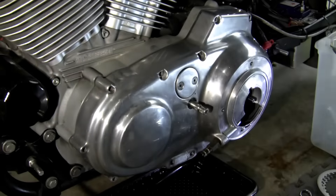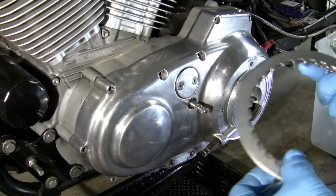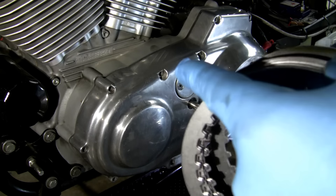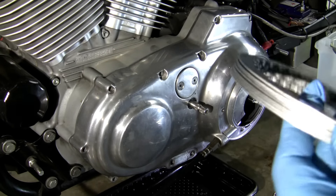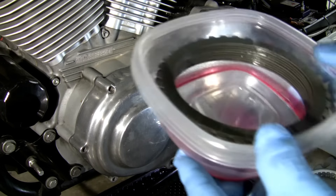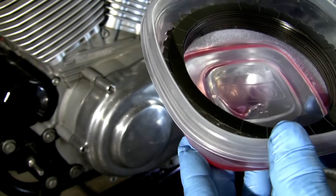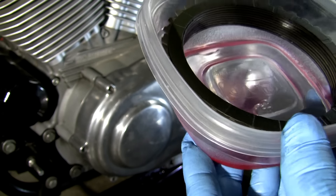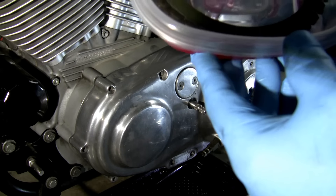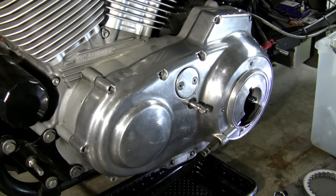It already has one in there, but I drag-raced this bike and I think one of the metals, or some of the metals got warped, because I'm feeling a little surging when I pull out the clutch. So I'm going to replace the metals and the fibers. I had the fibers soaking — I use automatic transmission fluid for this, as Energy One recommends, or you can use other lubrication like Harley or synthetic oil, whatever you use in the tranny. They suggest soaking for about 15 minutes before you put them in.